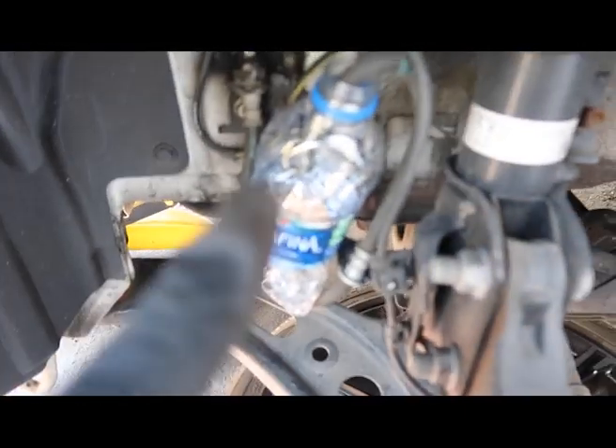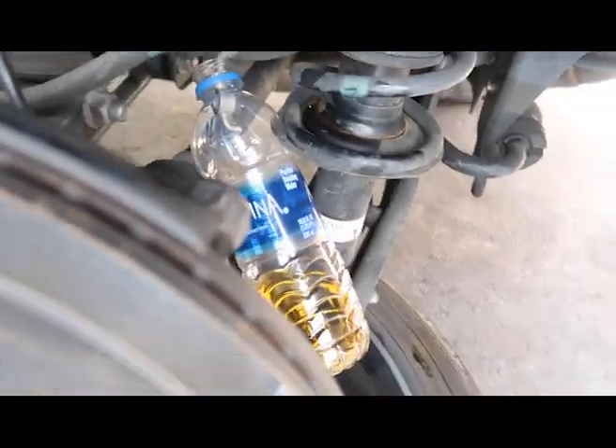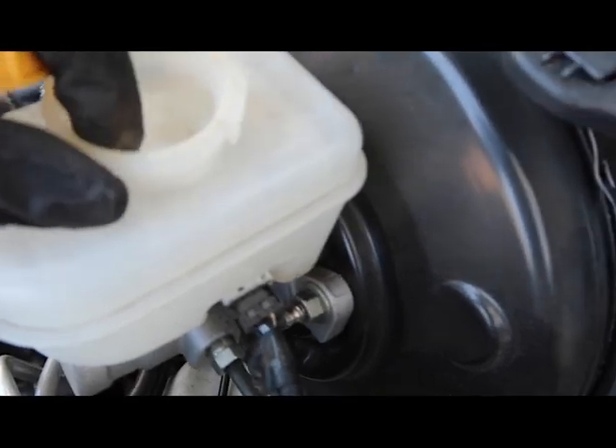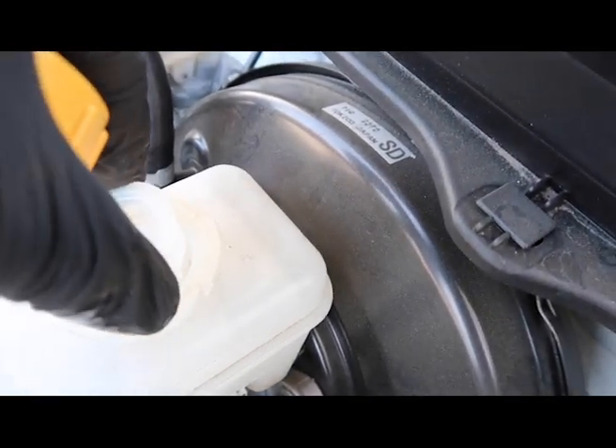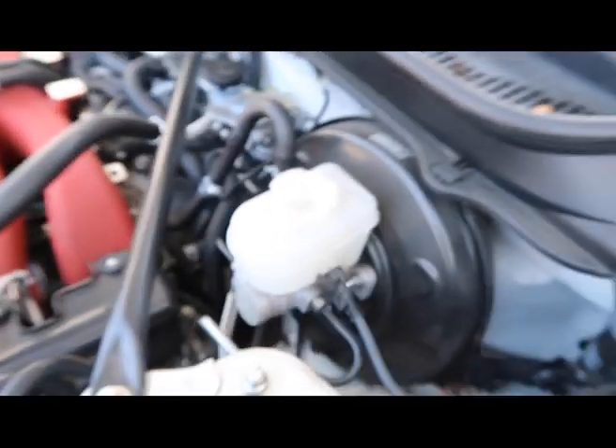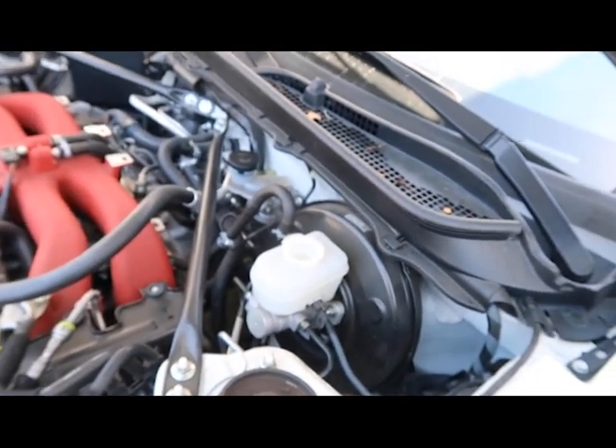It's expensive. You take these off - same thing, two bolts for each caliper. The mistake I made in the back was the bleeder valve - I should loosen that one off first. The brake fluid looks super clean. I put water bottles all around; this front one dripped the most. I went to remove a cap and it all just poured out - gonna top it off and figure that out later.